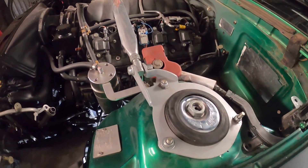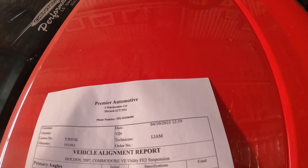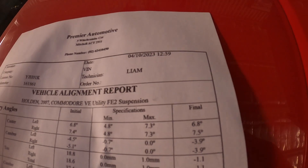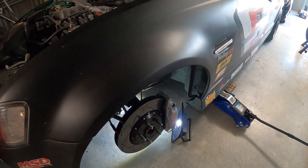You're probably saying Fred, this looks a bit more cambery and you've got some more cornering power — what are the results? Here's the alignment report. Front camber: we ended up with minus 4 and minus 3.9 degrees. In the rear we ended up getting minus 2, though that was just through some adjustment. Previously we were only getting around negative 1.8 to 1.9 degrees — so this kit works.